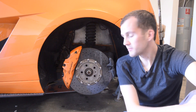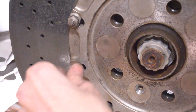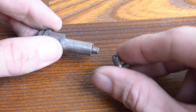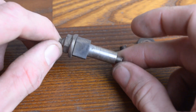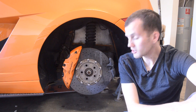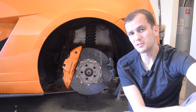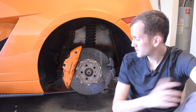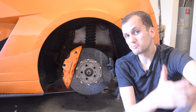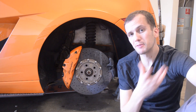What I wanted to talk about today is the carbon ceramic brake rotor bolts that actually came on the car. The problem is that over time they have a tendency to corrode and fall out. Lamborghini did try to fix this with a recall, but not all cars with the optional carbon ceramics were covered — mine included. I inspected all the brake rotor bolts when I picked up the car, but on the drive home they started falling out. It became so bad that I only had two fasteners remaining in my carbon ceramic brake rotor, which is really dangerous — if I hit the brakes one more time those bolts might have broken and I could have crashed my car right after buying it.